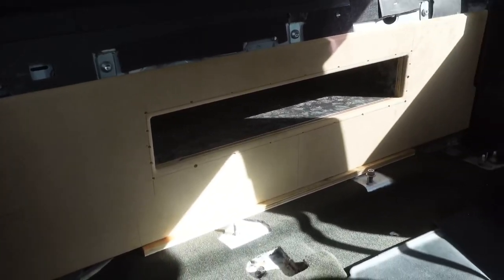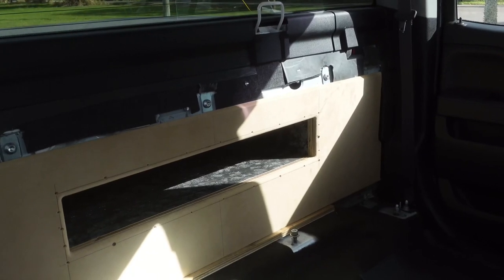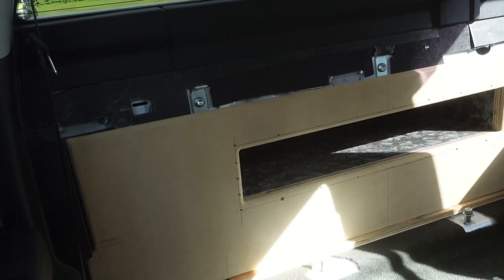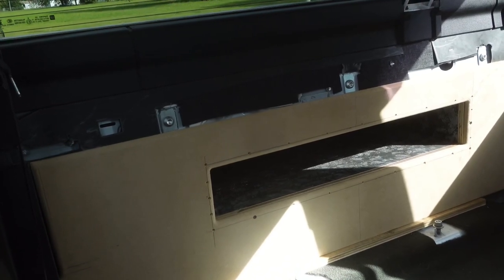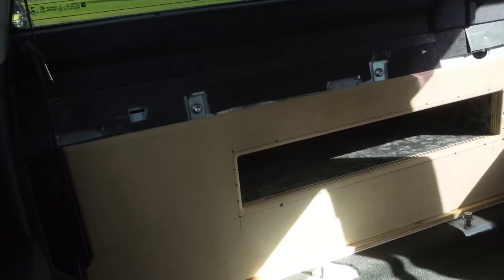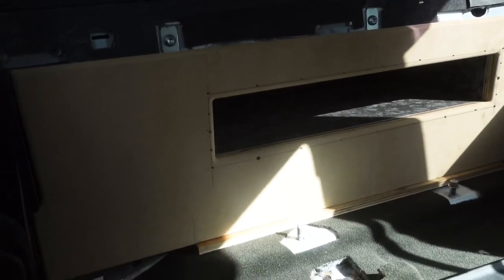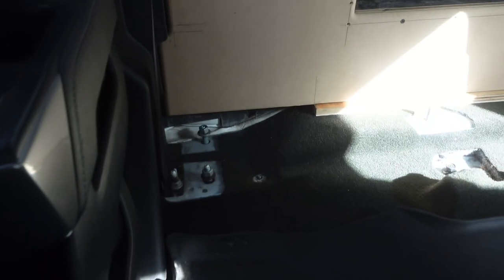The beauty panel for the blow-through is in. I'm going to wrap the wood in vinyl, and that top lip right underneath the plastic is going to get black carpet just so it can keep that factory look. I'm going to brush glue on that side and then put glue on the other side of the carpet and just stuff it in there, then lay it down to the contours of those bolts — just so it has more of a factory look. When we put the beauty panel on top of it, it's going to look like it was made for it. I had to cut those ears down in the bottom corners out just so we could get those bolts in for the seats.